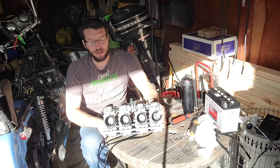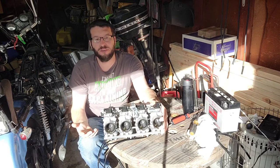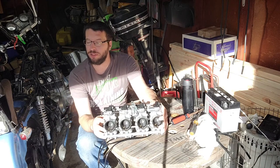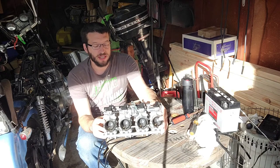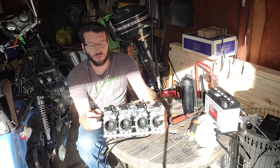One guy recommended, and I joined an Australian group on SXs because that's the only thing I can find, really. Also, a guy in Australia used these, so I figured why not. They seem like they really like these bikes a little bit more down there. So I joined in. He said to disable the accelerator pump because it was running pretty rich. But I said I'll play around with jetting and stuff, and we'll go from there.